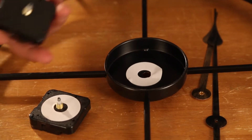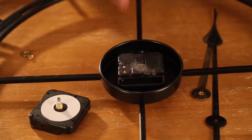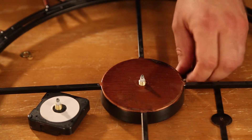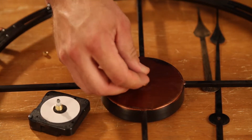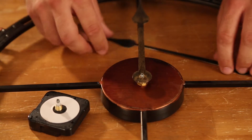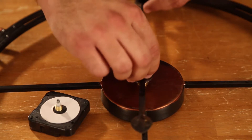Now we'll grab the replacement and stick it back on there. The battery generally is on the lower part of the clock and then you align it up with the 12, flip it around and you basically do the opposite. You need to put your washer in first, then your nut, then your hour hand — pointing up — and your minute hand. I always like to set it at 12 o'clock. That would mean that your time is set, and then you always use the cog on the back of the clock to set your time.